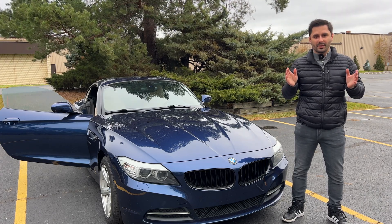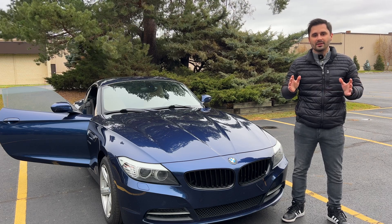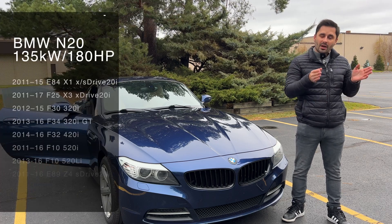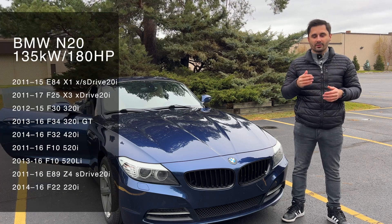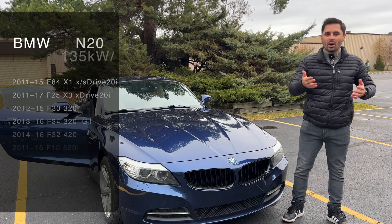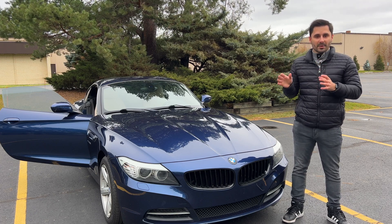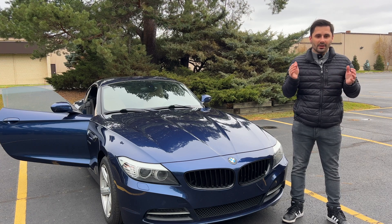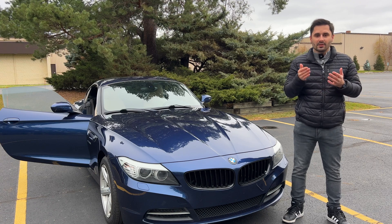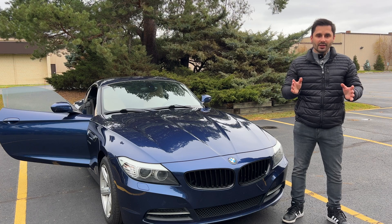There were a few different versions of the BMW N20 engine, manufactured from 2011 to 2017 and used in many different vehicles. Europe and other countries had the optional lower-powered 180-horsepower version in their 320i, 420i, 520i, and other something-20i cars. But in North America, we only had the 240-horsepower version, and that's the version I will concentrate on in this video, since the biggest difference is actually just tuning and the supporting mods, not the engine itself — so it mostly applies to both.